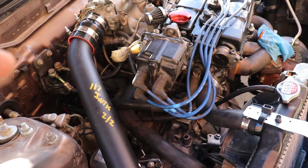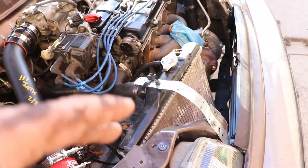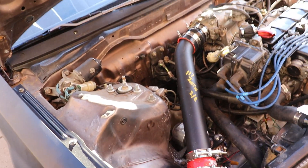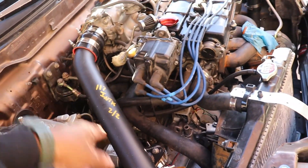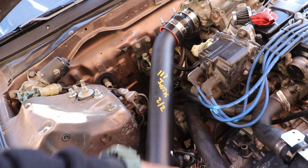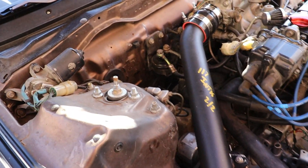When it comes to a turbo kit for the Civic EF, there's really not a standard kit for it. So I essentially pieced together from the pipe that came with the car and a few pieces online. For instance, I got this particular intake off of eBay — it looked like it fit in the picture and luckily it did, it worked out perfectly. This blow-off valve was extra large and really didn't work, so I drilled two new holes and made it work. We'll figure that out as we go.